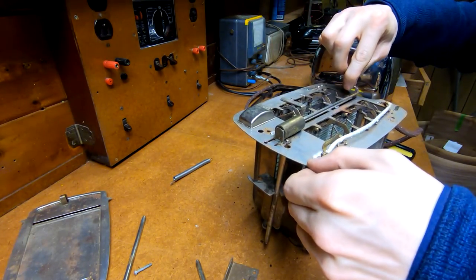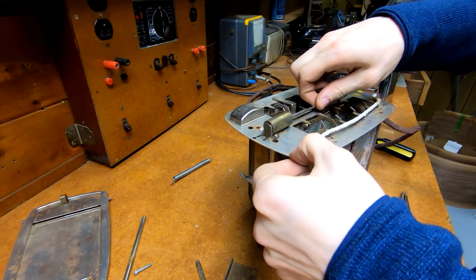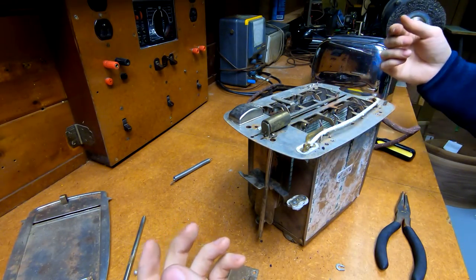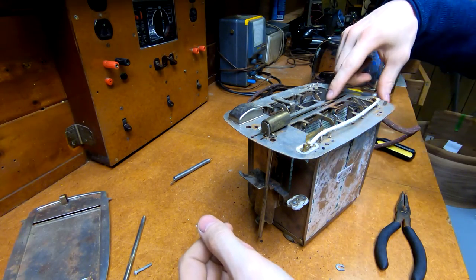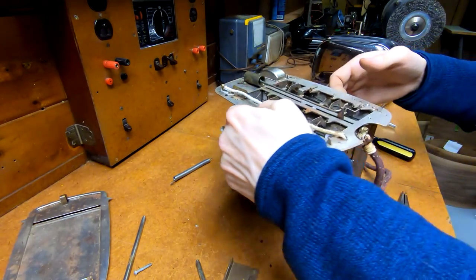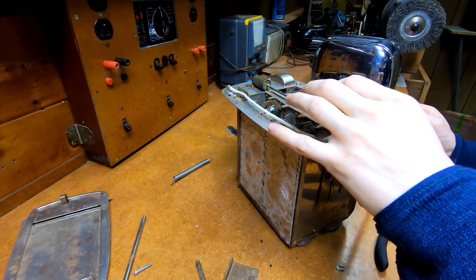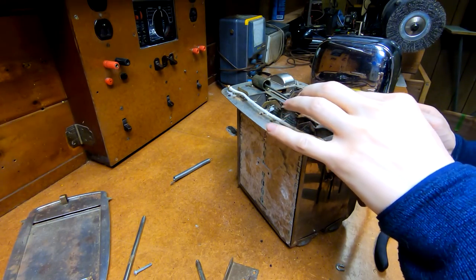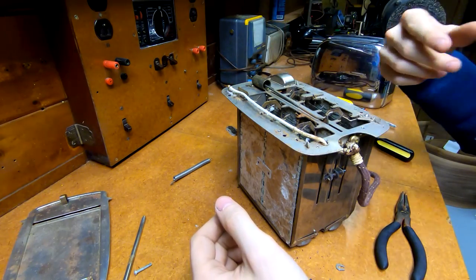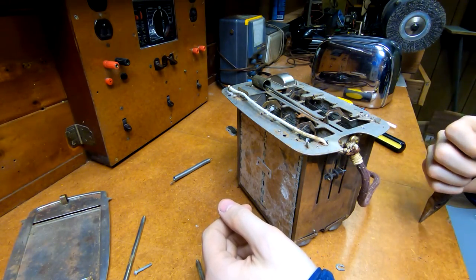So that's the main spring for lifting. Oh, interesting - this appears to be basically a damper, really. The walls of it are made out of brass, the piston is also made out of brass, and it's not a press fit - maybe more than a few thousandths of clearance. But it's just enough so that as it's trying to push down, the air is being squeezed into this tight chamber and trying to push past the thin edges of the piston, and so it slows the whole mechanism down.